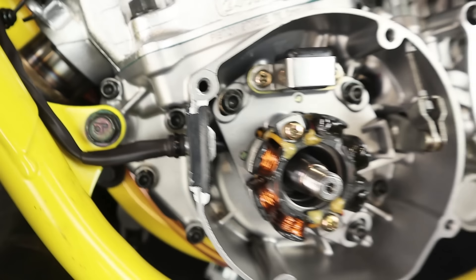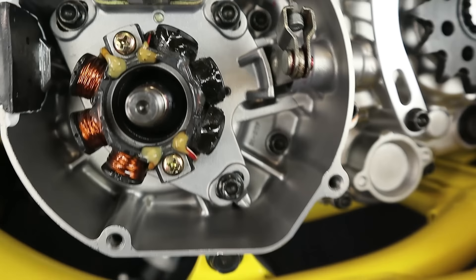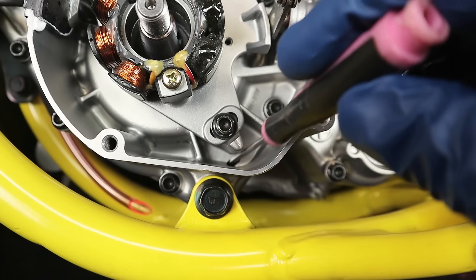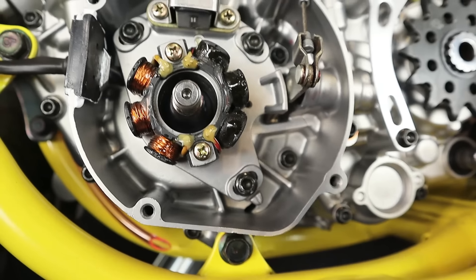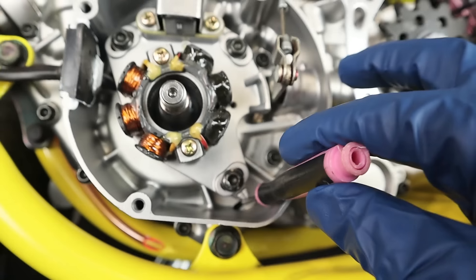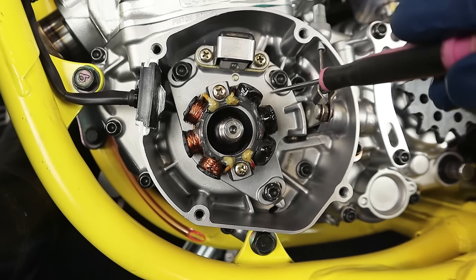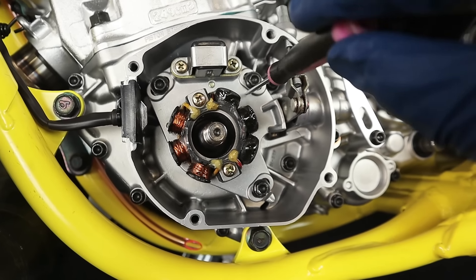You can also see the custom bushing I made so the heat shrink had something to grab onto as the wires come out of the engine. The next place you're going to put 1211 is down underneath the stator plate. There is a drain right here — because this is normally a dry side on these two-strokes — that needs to be filled with silicone. We don't want all the oil you're going to put in here to lubricate your starter assembly and gears to drain out and weep out the bottom of the case.